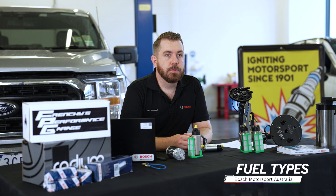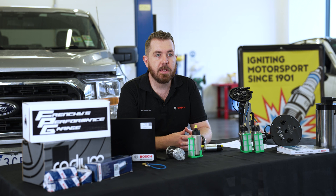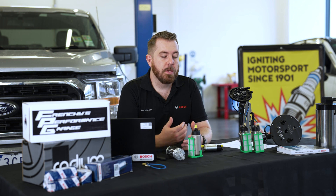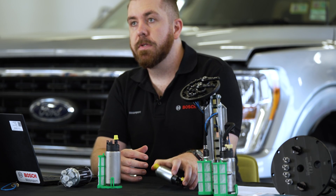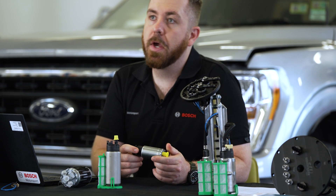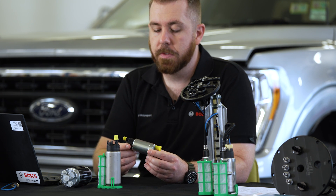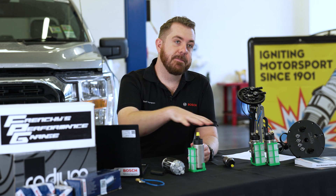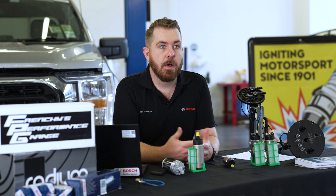The use of E85 fuels has increased in popularity in recent years and as a result we've seen a corresponding development in the range of aftermarket products designed to support E85 fuel. There are a few things you do need to be aware of when you convert your vehicle to run E85. First of all is chemical compatibility. E85 is a blend of 85% ethanol and 15% gasoline — that's where the name E85 comes from. Ethanol is extremely corrosive and destructive, and if a vehicle's fuel system is not designed for use with E85, over time you can see a reduction in performance and eventually a complete failure of elements of the fuel system. When Bosch Motorsport introduces an E85 approved pump, you can be sure that the internals have been developed specifically for use with ethanol and have been validated over thousands of hours of OEM level testing.